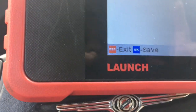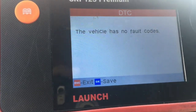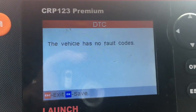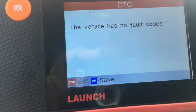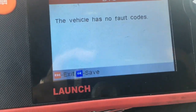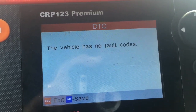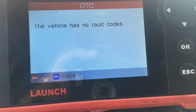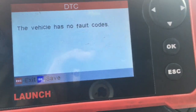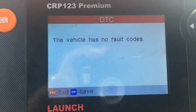That's a pretty good indication that everything is going to be okay. If you do a road test, just remember to follow the rules on the road. For a DIY mechanic, in this case we disconnected the battery. In other cases, people just disconnect the negative battery cable for two or three minutes, connect it back, and start driving normally — go to the shopping center or to work back and forth for a few days. If the light doesn't come back, your car should be ready for inspection.